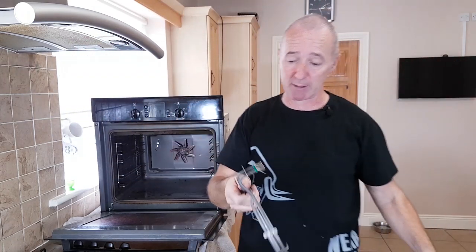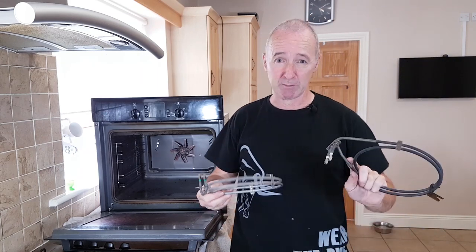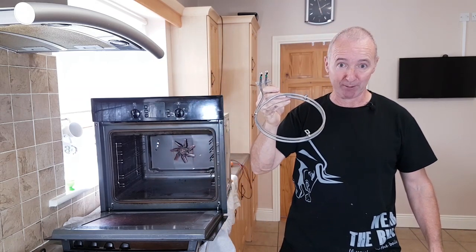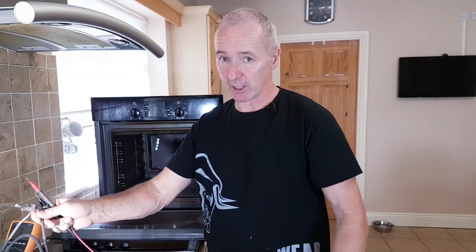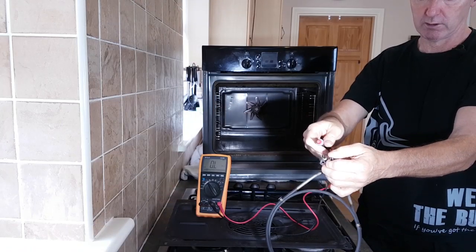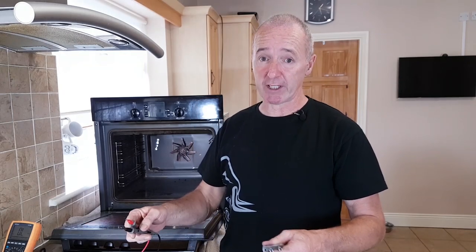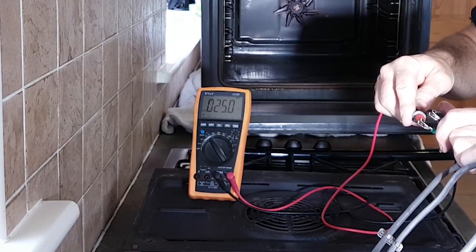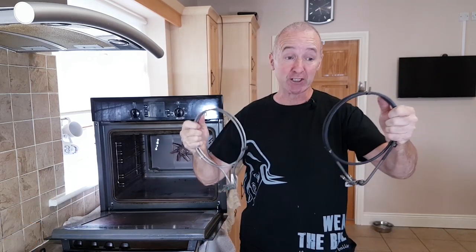The screws are not going to line up exactly so I might have to do a little bit of drilling. The original Bosch element was about 50 euro and this one was 10 euro — so a lot cheaper and I'm going to make it fit. Now with the two elements side by side I'm going to test resistance. On the old one we get no reading at all. On the new one we get about 24.8–24.9 ohms — that's the resistance which is how it works.